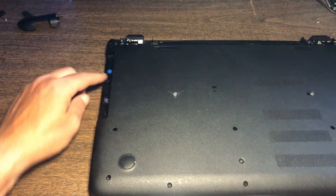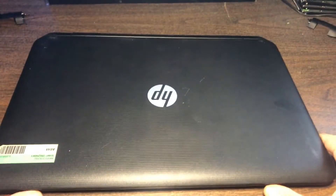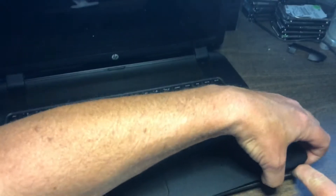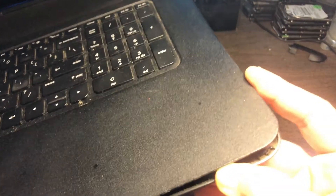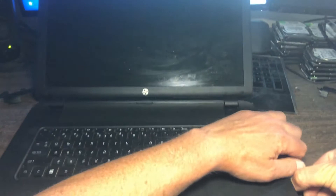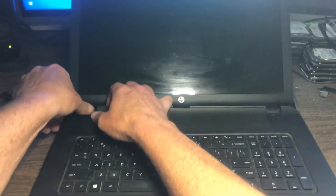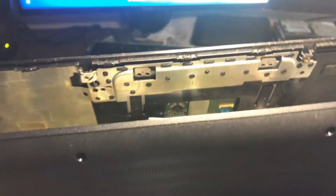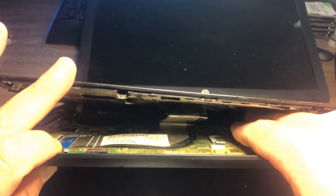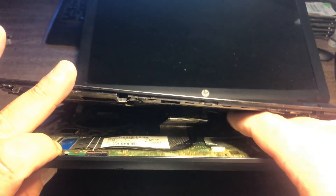You've got these little tiny, nasty screws. Take your laptop with all the bottom screws removed and flip it open. You'll see how it's separating there. Once you get it apart, you just kind of work it around with your fingers until it starts popping. There are some cables still attached — that goes in there like that — and I just lift up with my thumbnail and slide it out.